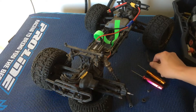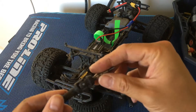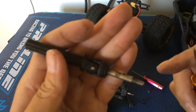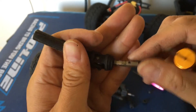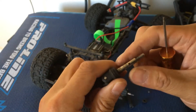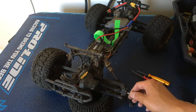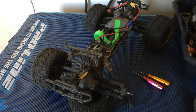In the previous video, I had thought that the driveshaft had gone bad and I actually completely misdiagnosed it. What I thought had happened was that this metal piece had basically separated from this plastic piece. You can actually test this by sticking a hex driver in there to see if that'll turn. So that's what I thought had happened because the wheels were not turning, but the driveshaft was turning when the motor was running, and so I had immediately jumped to that conclusion, which was actually completely wrong.